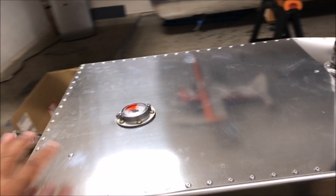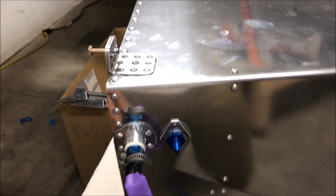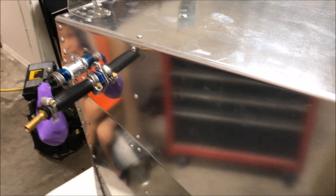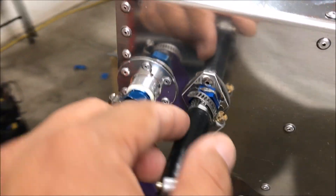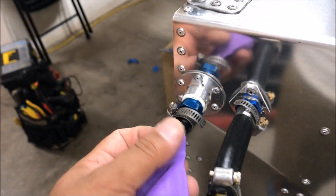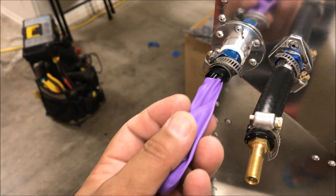There are another two on the bottom: fuel supply and return. On the fuel supply side I put the balloon there, and on the return side we're going to put the schrader valve. So we can put air through that — when we put the air in, the balloon should expand. When the balloon expands, we leave it that way for 24 hours.